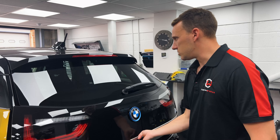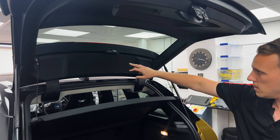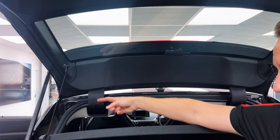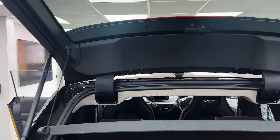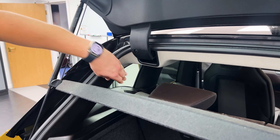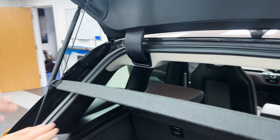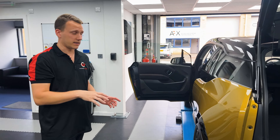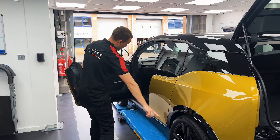This is the rear camera, which you can see as I pop it up — just connected. This runs through the plastic trim here, works down this section at the back, through the C-pillar, then runs down the seat and then the flooring. You actually don't need to drop the headliner for this part of the installation for this particular car.